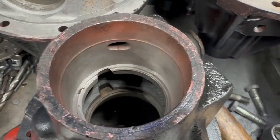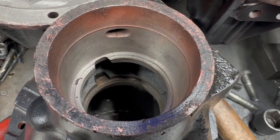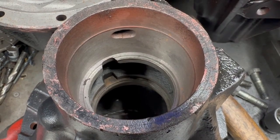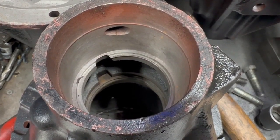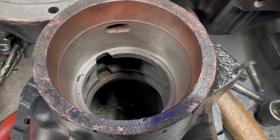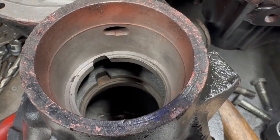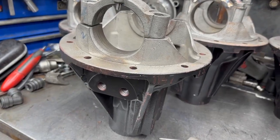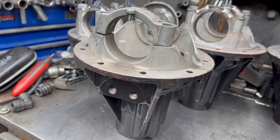I got a phone call that basically said, 'Do you want these machines slightly out of true?' I said, 'What do you mean?' He said, 'Well, the head and tail aren't actually lined up with each other.' So those have been corrected so that the head and tail are absolutely in line. That normally means we get a beautiful blue check and a bit of diff as a result. It's got its first coat of paint and its number — 1147.